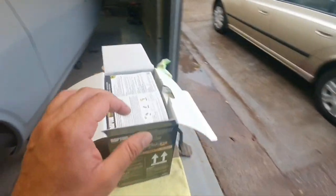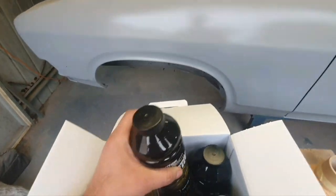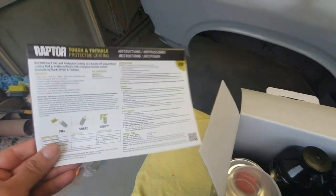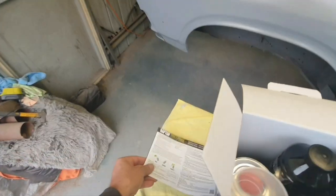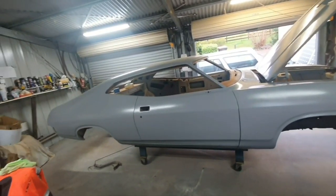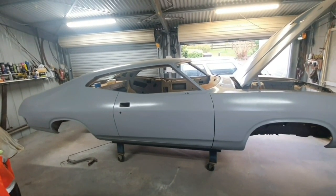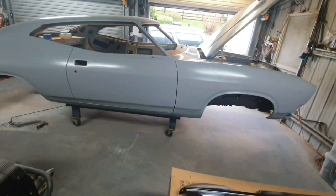Way too wet today to do anything really, just sand. All I can do is sand, which I have plenty of to do. I've got this Raptor stuff here — I opened the box up, pretty straightforward. I was researching last night the ways of applying it — you've got the roller method or you've got the spray gun. Reading up on the facts, they reckon you can reduce it up to 20% using a multi-purpose thinner. I was thinking you can save yourself a crap load of time rather than using a roller. I've got a spray gun with a two-and-a-half mil fluid tip, so it should be really good for putting it on really quickly. But today's not the day for it — it's just too cold and wet, humidity's 100%.